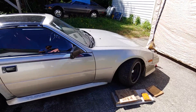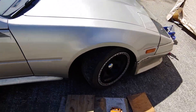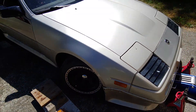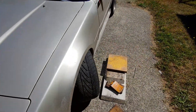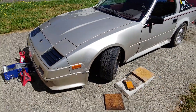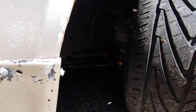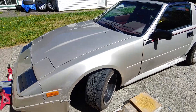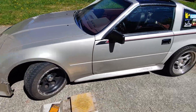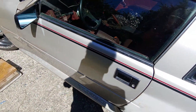So the adjustable tension rods are in, along with modded knuckles, extended arms which are stock S13 — about an inch longer than my stock arms — and the modded knuckles are cut about three-quarters of an inch shorter than stock. I also have the offset rack spacers and the adjustable tension rods. The wheels now sit really nicely in the wheel well. I'll turn the wheel and we can check that out.